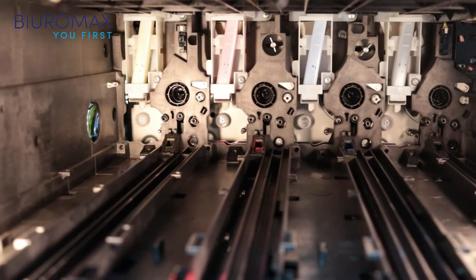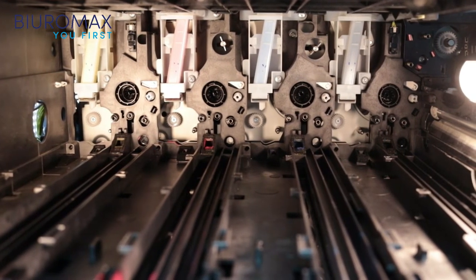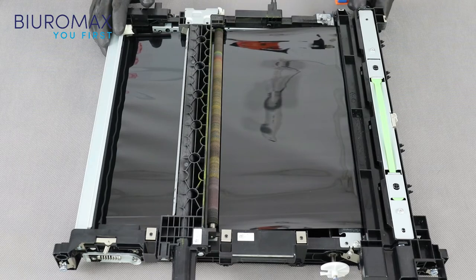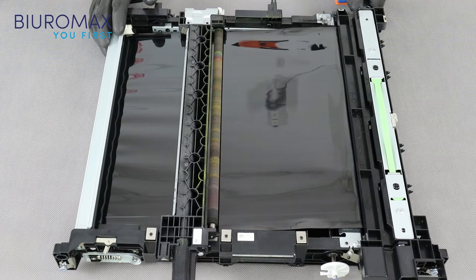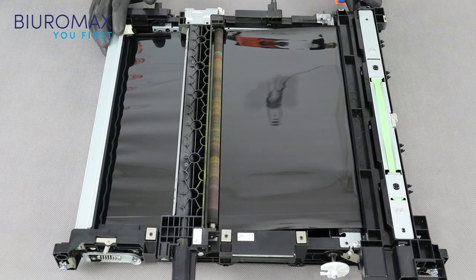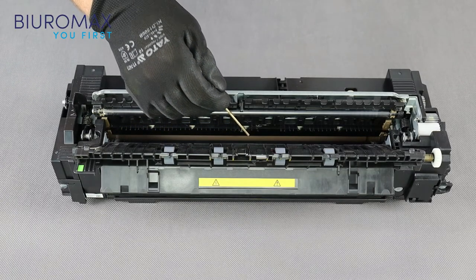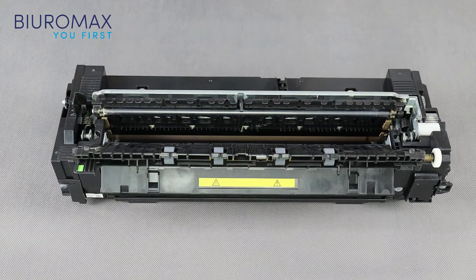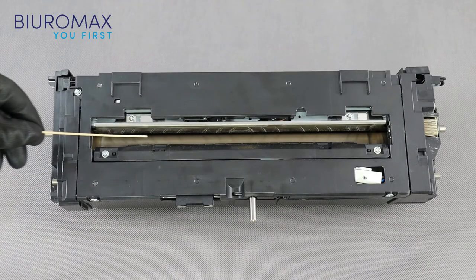The inside of the machine is free from dust and toner — the copier looks perfect. The transfer belt is not dusty and has no defects. The waste toner discharge channel in the cleaning unit is not obstructed. In the fusing unit, the surfaces of the lower roller and the heating fixing film are clean. No hardened toner was found under the metal separator and the working surface of the rollers is clean.